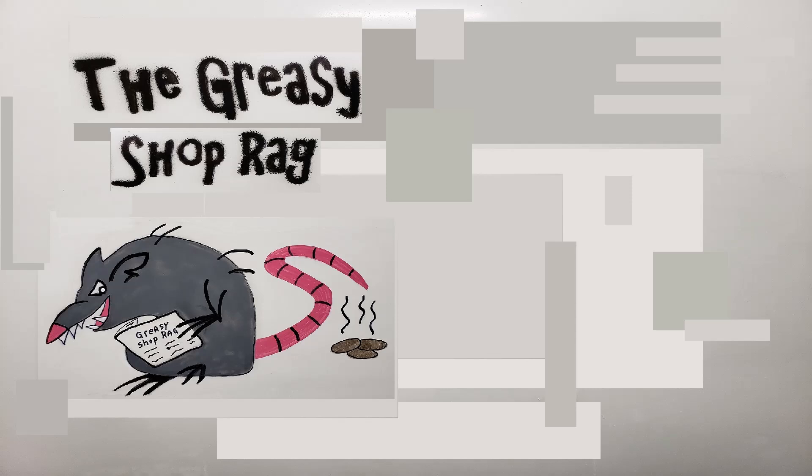A big air leak could be the issue too, but the way it was running — it didn't so much bog as it starved for fuel, slowly petered out and died. There's a subtle difference, and that's kind of the whole trick when you're working on these things: recognize a symptom and associate it with the actual problem. I gave you a list of the things I think could be the problem.